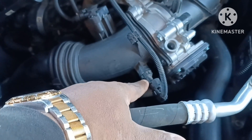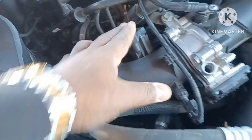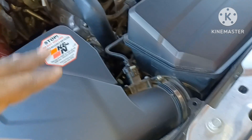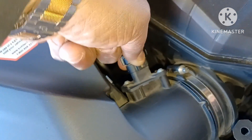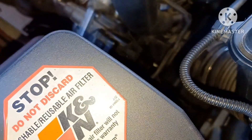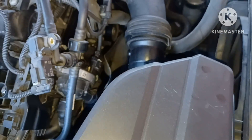You'll be taking off adapters — this piece comes off the charge pipe, and the mass airflow sensor comes off too. These are all intake sensors: air intake temp sensors and things like that. First thing is taking off the air box — pop this little clip out, pull this back, and that'll come off. Then take off this big piece so I can get my hand down in there. I want to figure out how to get down there without taking off too much, because if you break something you've got to put it back together.